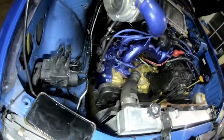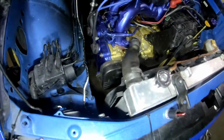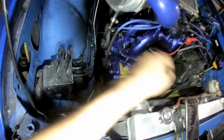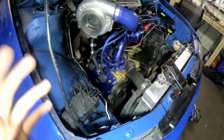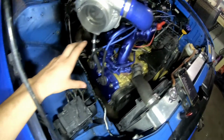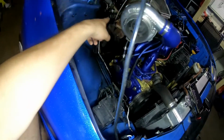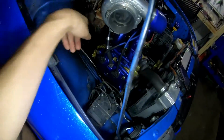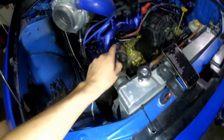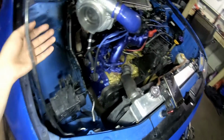And if we go to the bottom where the oil returns at, you will see I literally have it routing straight to my valve cover breather. And this is only on my application that I can do this, since the turbo is so high up and so far forward. The stock turbo setup is like the turbo will be right here, and then the air filter will come through that area. And I didn't do it that way, so I got lucky.